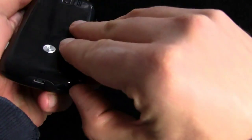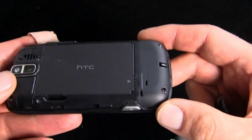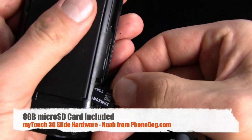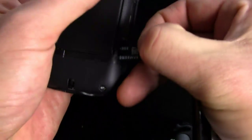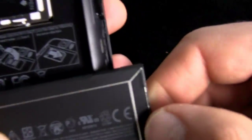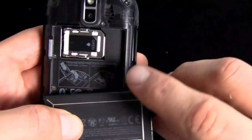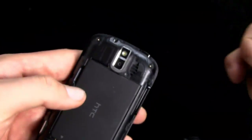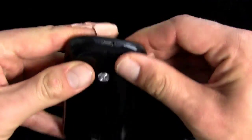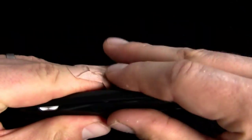Let's look at the back. Here's your battery, and on the side is your micro SD card slot. The phone came with an 8-gigabyte card pre-installed. We'll pull the battery out — you've got a 1,300 milliamp-hour lithium-ion battery. Here's your SIM card slot. It's GSM quad-band, using T-Mobile's AWS banding. So theoretically if the phone were unlocked, you could use it on AT&T or GSM networks around the world, but only with EDGE or GPRS data, not 3G, because of T-Mobile's proprietary AWS 3G bands.